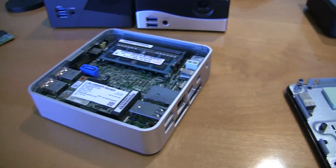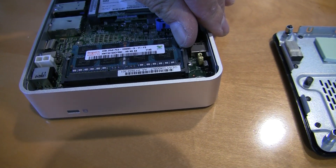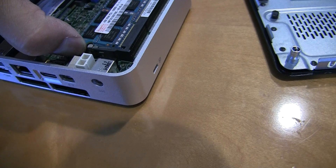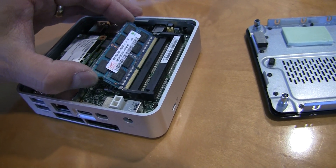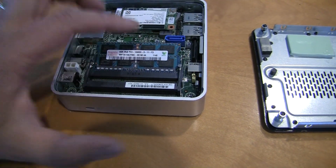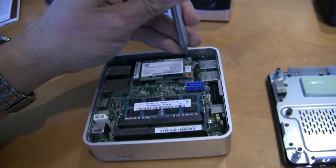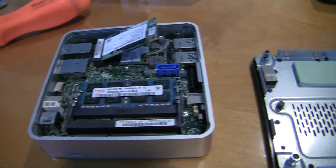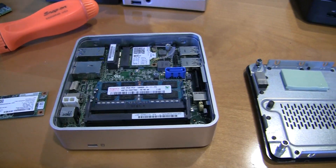There's still memory in here, just got to pull it out before we send it back. Inside you will see standard DDR3 low voltage slots — there's two of them. If you don't know how to do this, we actually showed you how to build your own NUC, you can look at that video. You put the memory in at a slight angle, normally you would use both thumbs, push it in until the edge connector has kind of disappeared, and then bend it down. This is the mSATA drive and Wi-Fi — I believe Intel sells these units without the Wi-Fi card.